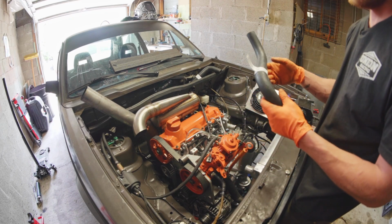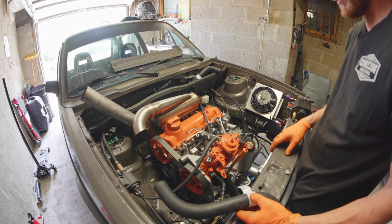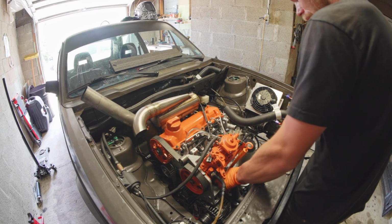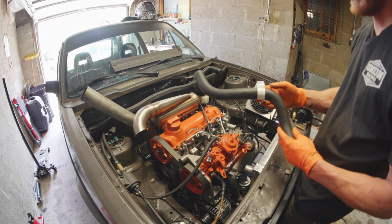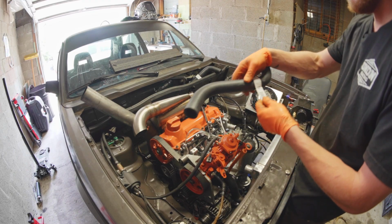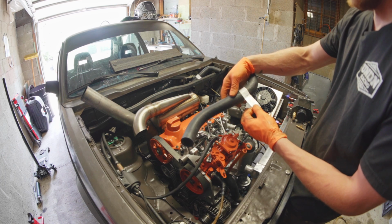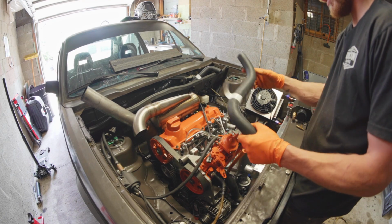In case you were wondering and you just wanted to go pick up a hose that works for a TDI swapped into a Mark 1 radiator situation, again, reuse your original upper radiator hose as your new lower, and then go buy one of these. It's a Duralast 62671. That's what it looks like on the tag. This thing works perfectly as the upper hose, which is awesome.